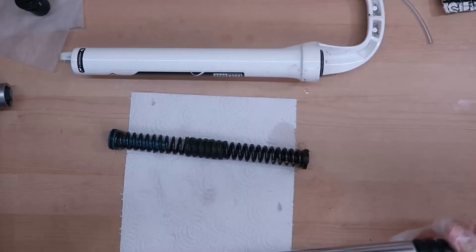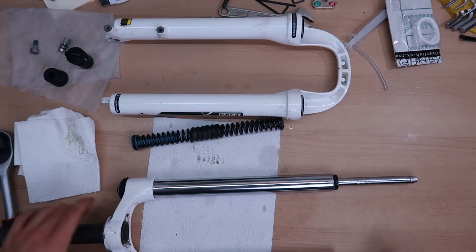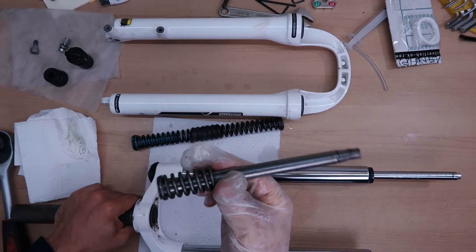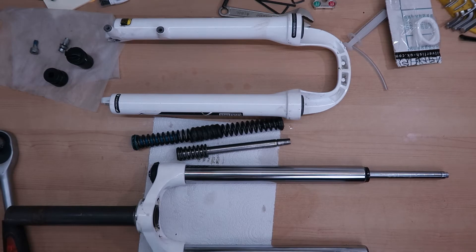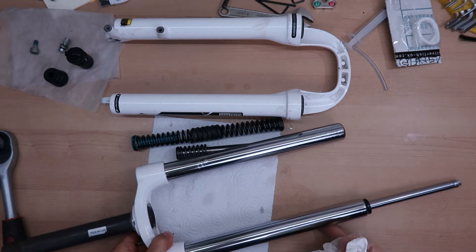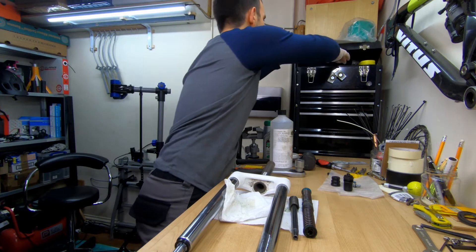The spring is out — wow, the spring also looks great. Bottom-out bump stop removed. Let's carefully slide this out — yep, this one is also in good condition. Let me try to cycle through the damper side and see if it moves smoothly. A few moments later — confirmed, damper side is working as expected. For the spring side I'm gonna use just general grease.